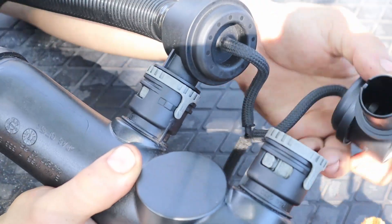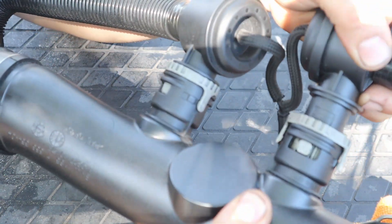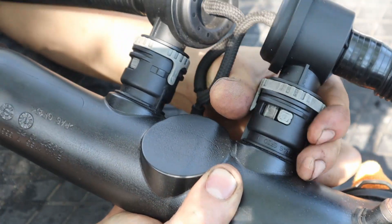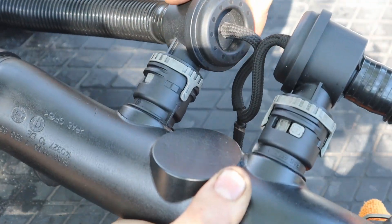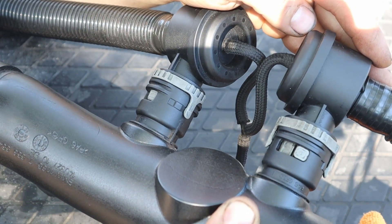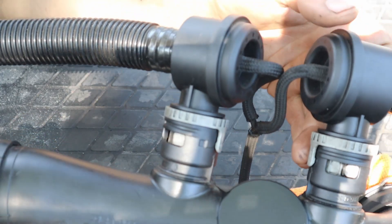It's locked back in. Same with this one — make sure you don't roll your o-ring in there, make sure it slides in nicely. A little twist to get it in the right spot, click click, right in, lock it. You're good to go. If that doesn't fix the oil leak or boost leak issue you're experiencing, then you're gonna have to replace your seals. That should do it — thanks for watching guys, take care.